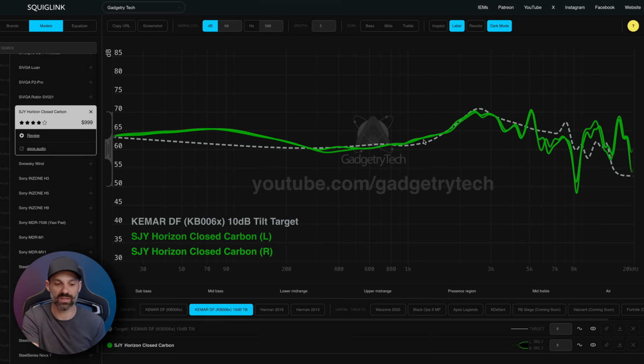You can see a little bit of a lift just about 1200 hertz on my rig, but it's super minor. Honestly, this is voiced well, and when you compare it to some other headphones, the Dan Clark stuff in particular tends to be a little bit stronger, especially close to like 2K and 3K. They're a little bit more forward. With this guy, the big change with the Horizon, at least what stands out to me, is the high treble.